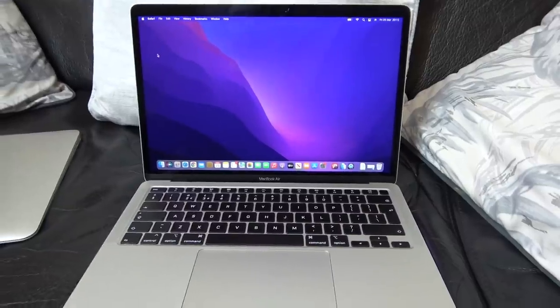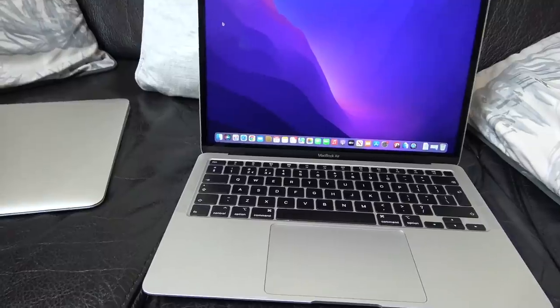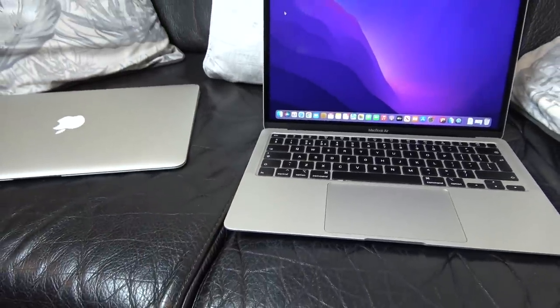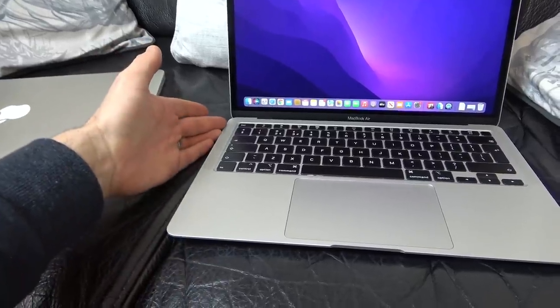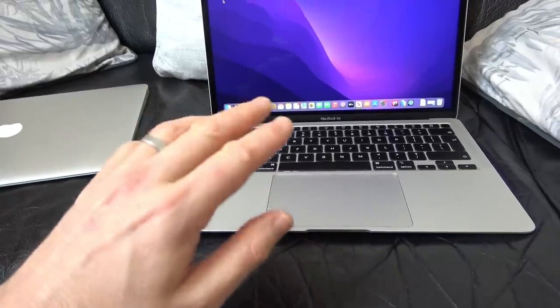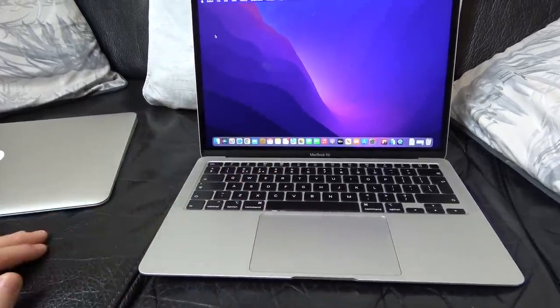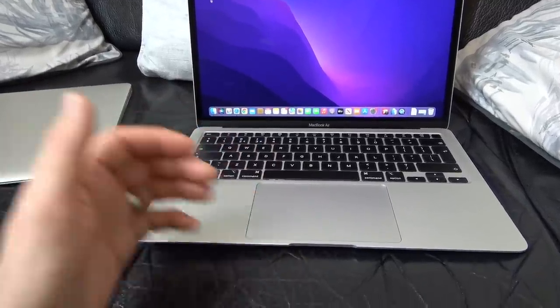I can't believe it was only £200. I can't believe it was such an easy repair. All fixed from a part that you can get all day long, again from eBay, for under 10 UK pounds. So wasn't that interesting? The very fact is that it was putting some kind of short on it, because on both ports we had that pin shorted to ground, and that's the reason why it was probably trying to connect, dying, trying to connect, dying.